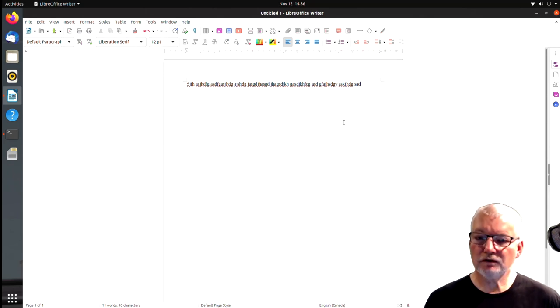So I look forward to potentially in the future maybe getting a version of this with more eMMC and maybe more RAM as well, certainly more eMMC, so that Windows will have a better time, because you know when Windows runs out of hard drive space, it starts to crawl because it's trying to swap and things like that. Ubuntu here, no issues whatsoever.